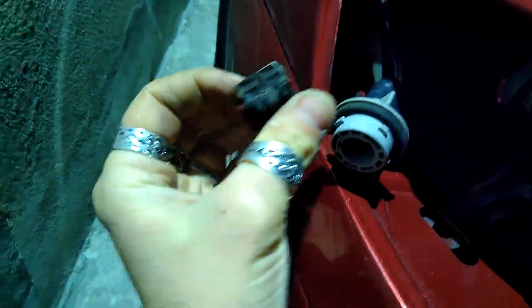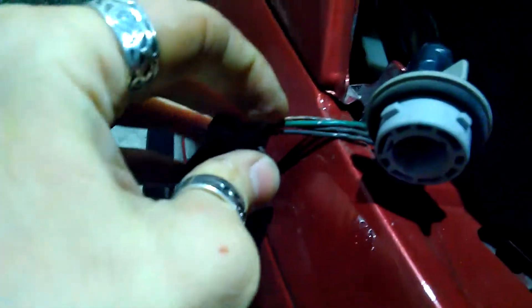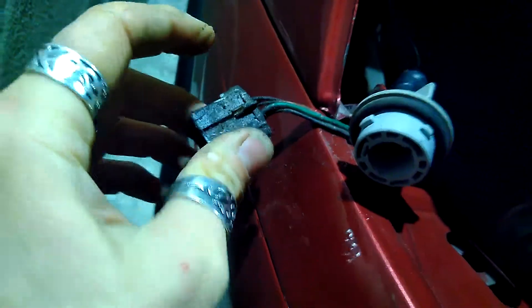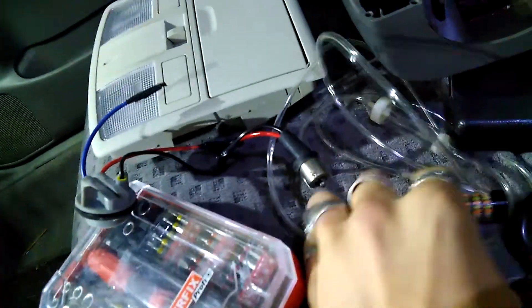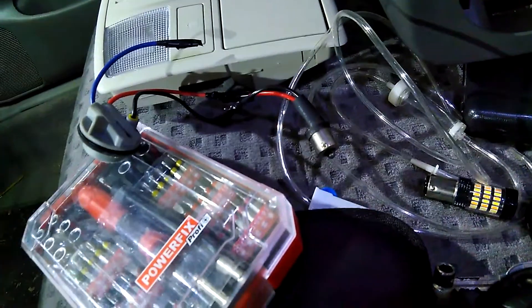Now this wire — if we go out and come here onto this connector — you're gonna find the wire exactly here. I'm hoping and I'm gonna test this to see if that's the case. So if I actually pass ground to this wire and connect my other relay there, when I pass ground to here I'm gonna get 12 volts there. After that you connect the 12 volts to here and you actually get this up and running. Let's check if it's gonna work like that.